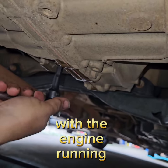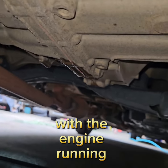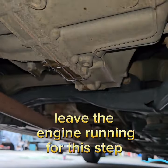Now what you do, take your plug out. And it's only going to drain down to the top of that level tube. So it's going to stop as soon as it gets to the top of that level. And that's the right level right there. And this one gets torqued to 15 foot-pounds. I've changed the torque wrench back from 29 to 15.